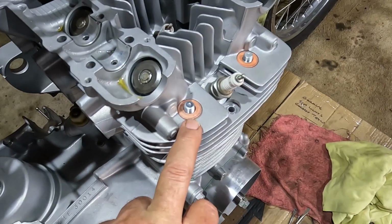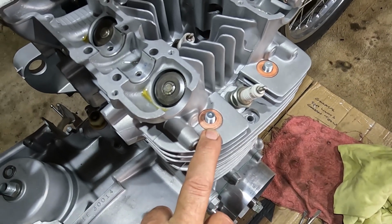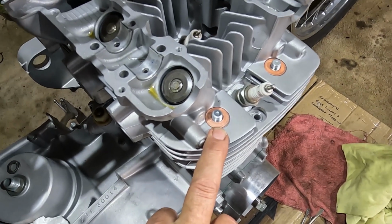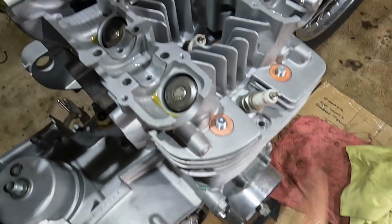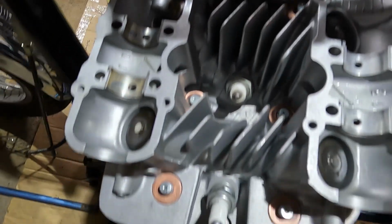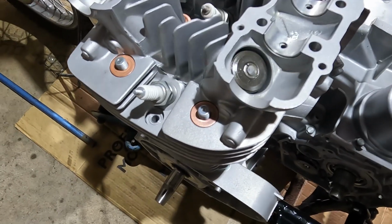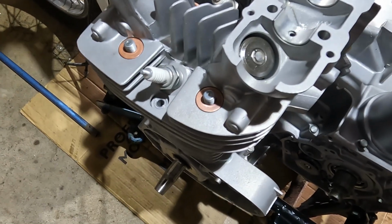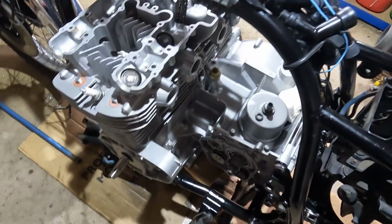We've cleaned these washers up, we annealed them, which, as I said earlier in the video, is putting them under a good blow lamp flame, gas burner, whatever, get them cherry red and then drop them in cold water. And if you look down there, you'll see they're all nice and clean, all ready for their nuts, the cylinder head nuts. And then tomorrow I'll probably start torquing that down. But I've got to clean the nuts off first, guys, and then when that's done we can go back to it tomorrow.